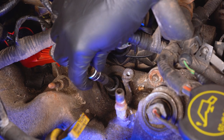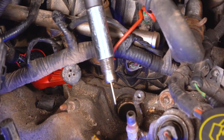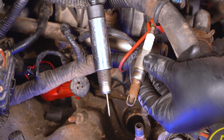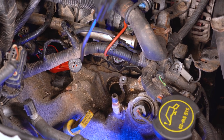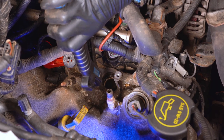As I was unthreading this spark plug, I was excited because it didn't feel like anything wrong was happening. But as it turns out, I only pulled out the top half of the spark plug. This is what it should look like when the whole thing comes out. To repair this, the first thing I strongly recommend is getting yourself some compressed air and blowing out any extra debris that might be in there.